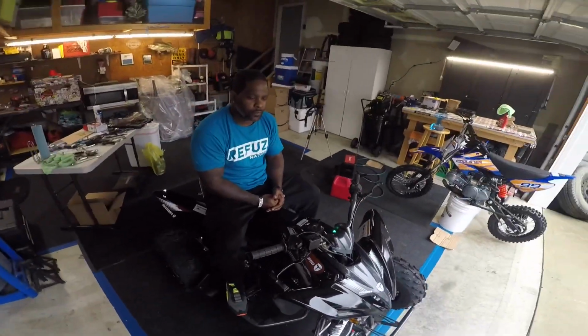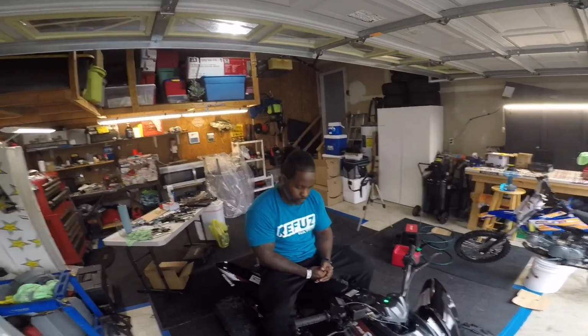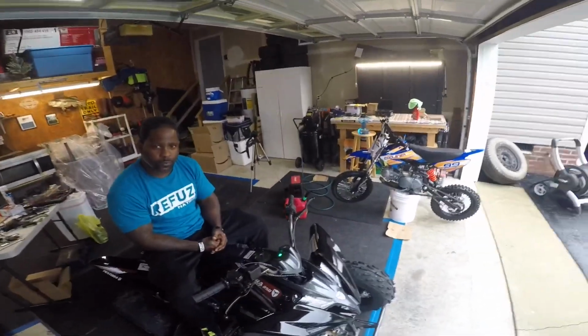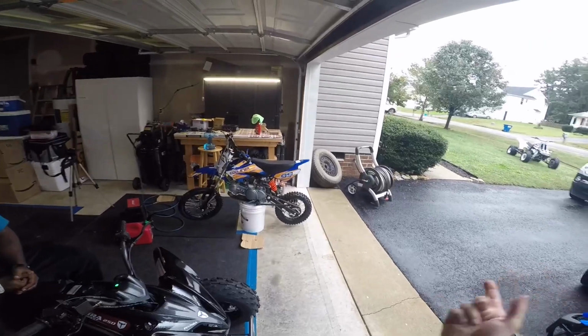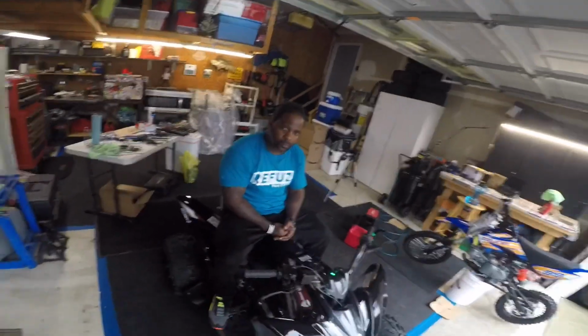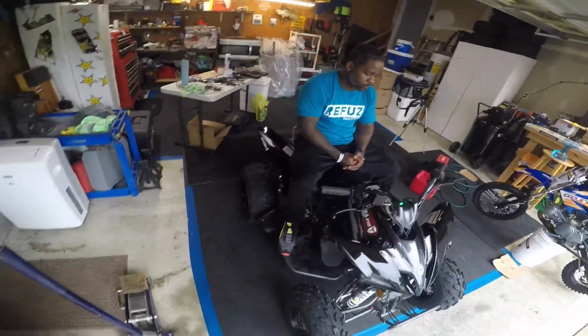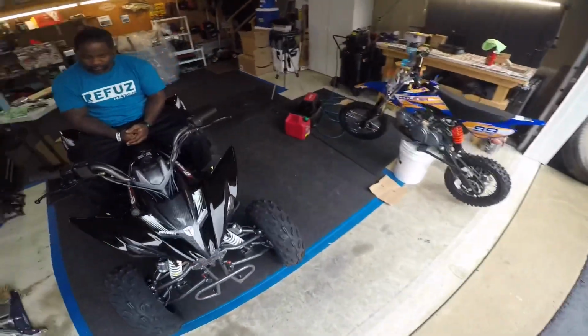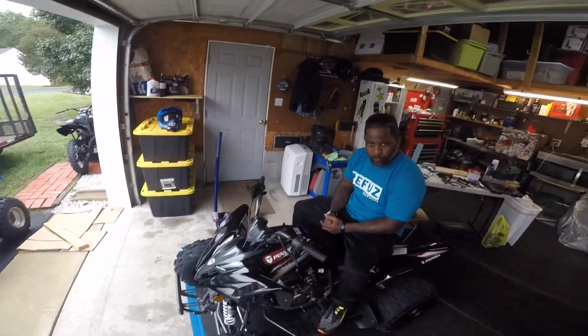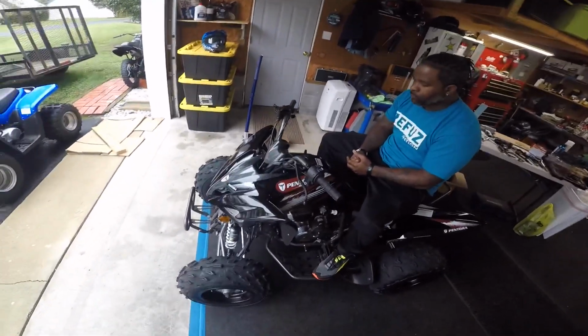What we're gonna do is we're gonna do it like halfway, like half throttle, just nice and easy, nothing crazy. Be easy on it for about 10-15 minutes, probably do a lap or two around the neighborhood, come back, shut it off, let it cool all the way down. You gotta do that about 3 times, just doing the heat cycles on it. What you're doing is you're setting the rings, you know what I'm saying, the rings around the piston.